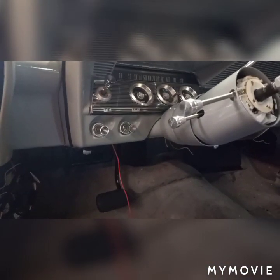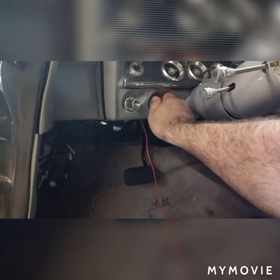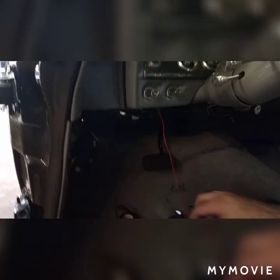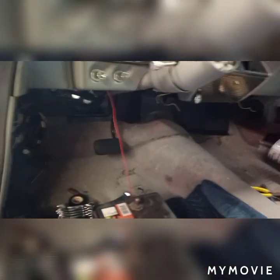Alright, we've got working wipers. Got the switch wired up and in place. Used the original bezel, original switch, and the original retaining screw or nut. It's 2-speed. The arms need a little bit of WD-40. Anyways, all I have left to do is hook up a good ground anywhere. Got my ground wire right here, and you hook up that power wire to a 12-volt accessory with a 10-amp fuse, is what the directions say.